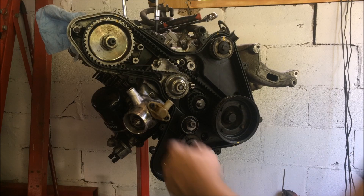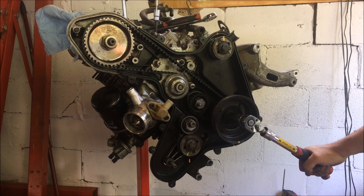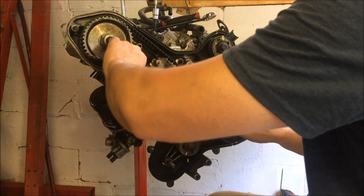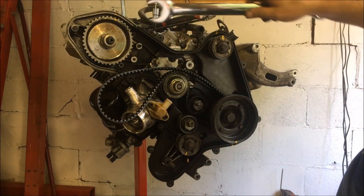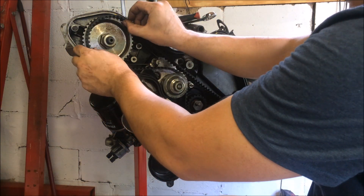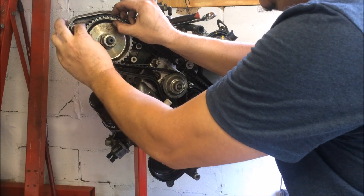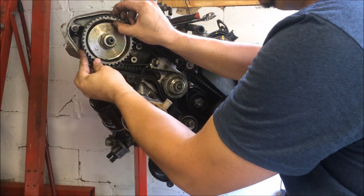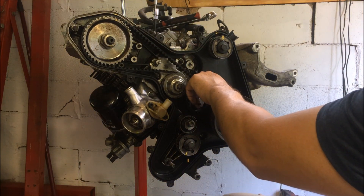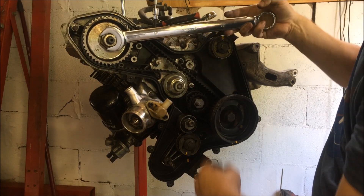Let me show you how to get this slack out and still have the car perfectly timed. I'm going to start by turning the crank back to top dead center again. Now that I have the crank back to top dead center I'm going to take the belt off the cam sprocket. Then I'm going to take the cam sprocket and turn it forward about one tooth — that's going to allow me to remove this slack, and then everything will be perfectly in time when I move it back. See, I'm just about a tooth off and I still have that slack there. Now watch as I move it back — I'm perfectly in time now and I have no more slack here.